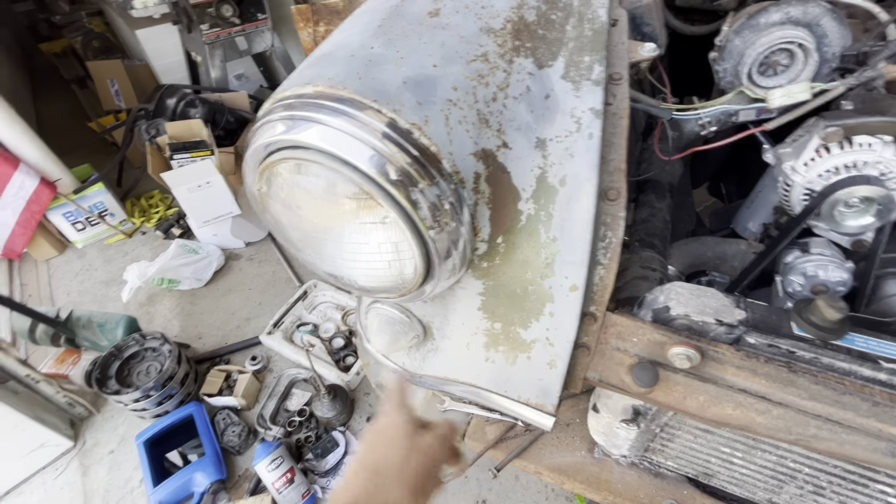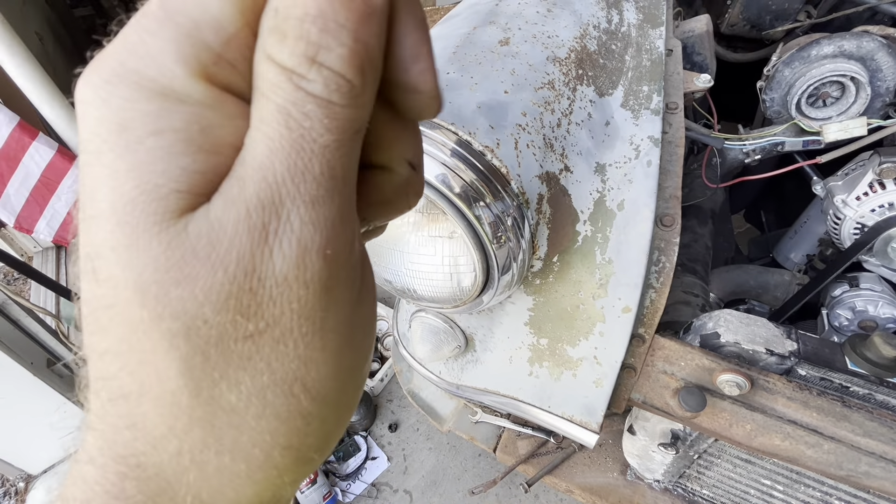I don't have a clue on when I last stopped filming — probably when I filmed the battery box. But since then, I've gotten most of the wiring hooked up to make the car work and got all the lights working. I had a problem with the passenger side turn signals — it was dimmer and faster on that side, but it also flashed both sides and wouldn't flash at all when the running lights were on. It was crossing over to the running light wire. The signal wire was crossed over in these two wires here — either in that socket or behind it. For now I just wiggled it and it's working. I'd like to get it fixed or replaced, but for now I'm not going to.